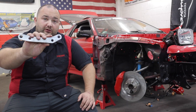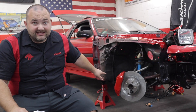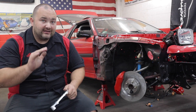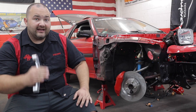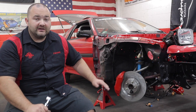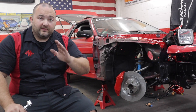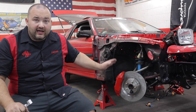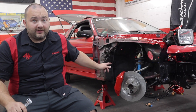I finally got a batch of CNC machined billet aluminum brackets. These brackets allow you to mount a massive Lexus LS 460 brake caliper — it's got to be from the all-wheel drive LS 460, not the rear-wheel drive. It also allows you to use a Lexus RC 350 F Sport rotor, which is absolutely massive at 356 millimeters. A lot of people have asked if you can use an ISF brake rotor since they're the same diameter — you cannot. The ISF rotor has a different rotor height, so it has to be the RC 350 F Sport rotor.